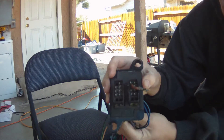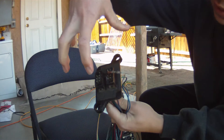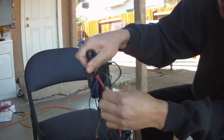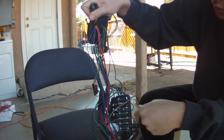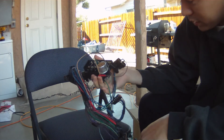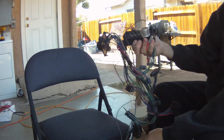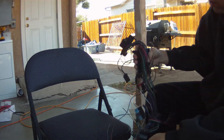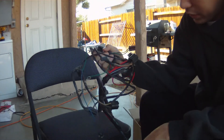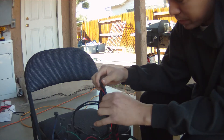And then this is the fuse panel hookup at the firewall. This is the engine bay side, this is the cabin side. And you can see that wire's just melted right out of its casing there. The other side of the fuse panel — this part is not too damaged. And you can see on its way to the battery, that wire got so hot it melted the wrapping to it.